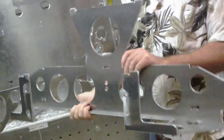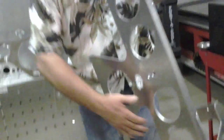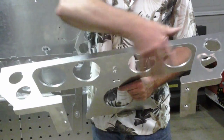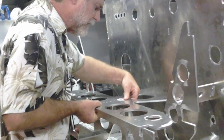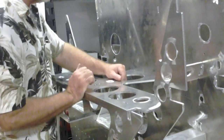Part number two - this is again one piece that's been cut and bent, but it's all one piece. The rack and pinion goes on these brackets right here. Notice the left and right rack and pinion mounts are not symmetric to each other - this side is in a little farther and up a little farther. That's to accommodate the rack and pinion mounts. The pieces are going to go in here like so. Dog bones go in here, line it up this way with the firewall. Dog bone right here comes in, which now locates this and this one as well.